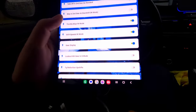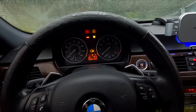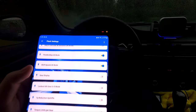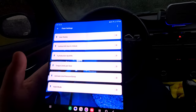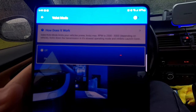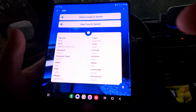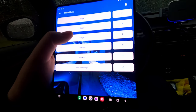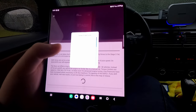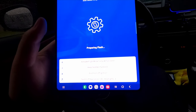Gear display will show in the cluster — in manual mode it'll show M1, M2 etc., but I'm going to remove the drive display. Valet mode is really cool — you give it to your brother or a valet and it limits the RPM to 3000, which is real nice. My battery is brand new so I'm not worried about that. So let's go ahead and flash this — praying nothing goes wrong. Stage three, flash it, apply custom flash settings, go to version 3.1, and here's where we wait.